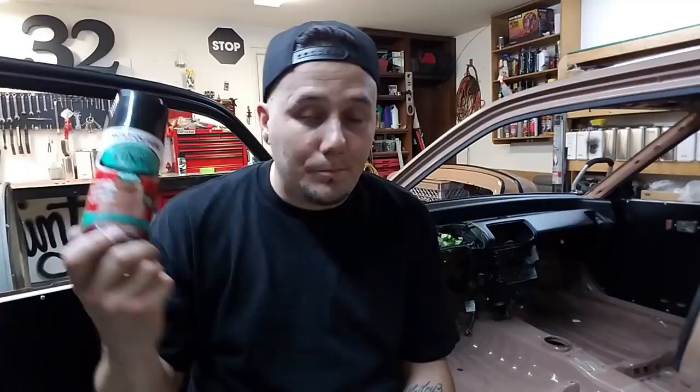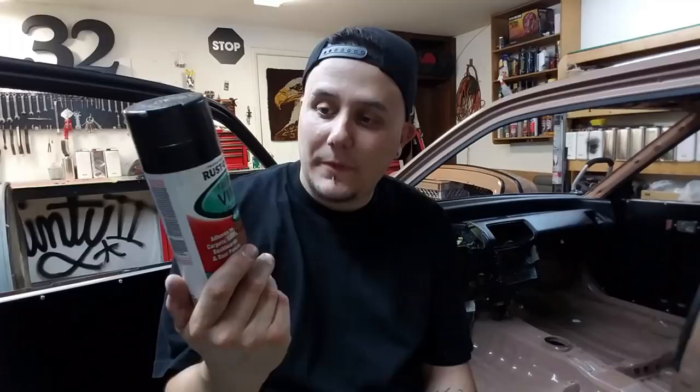And I know a lot of you guys are probably intimidated by the thought of using a spray gun. Oh, using a professional gun to paint. I'm telling you, once you get a gun, and once you get used to spraying with it, it's like night and day. You will struggle to do a decent spray paint job once you have spoiled yourself with having adjustable air pressure and adjustable flow of paint and an adjustable fan, for Christ's sakes. This thing is like spraying like that big.